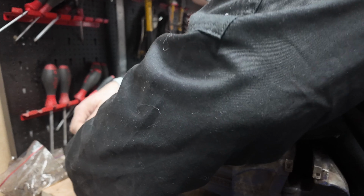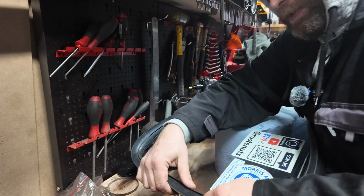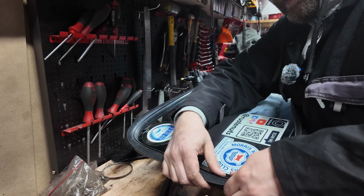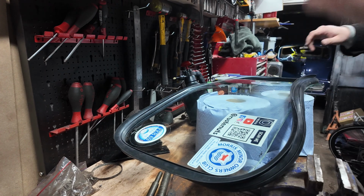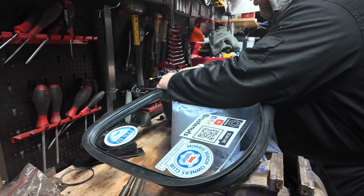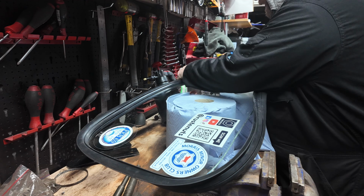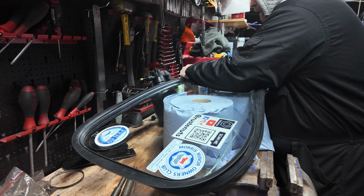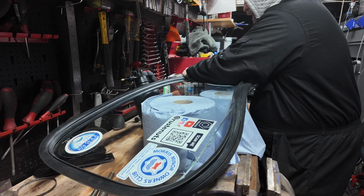although I am starting to lose my temper because, well, thanks for your help. As soon as you let go of it and try working it down the glass, it comes off. And all of the time I'm trying to do this without putting any pressure on the glass, because although it's laminated, it's not going to be as strong as a modern windscreen.